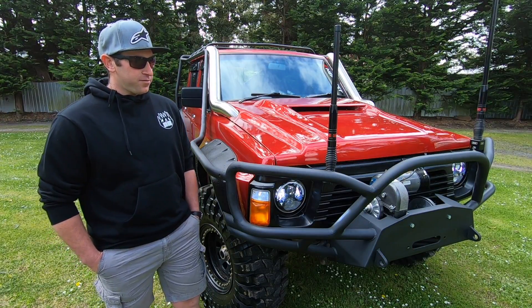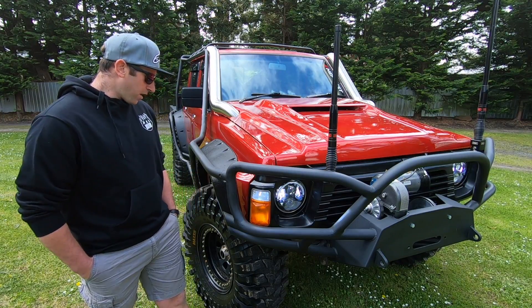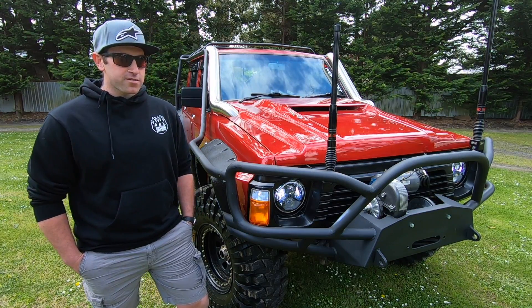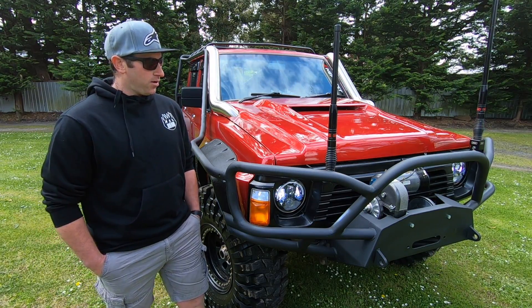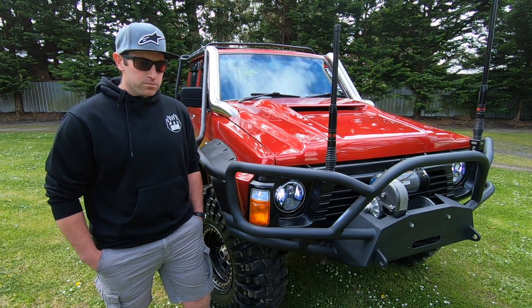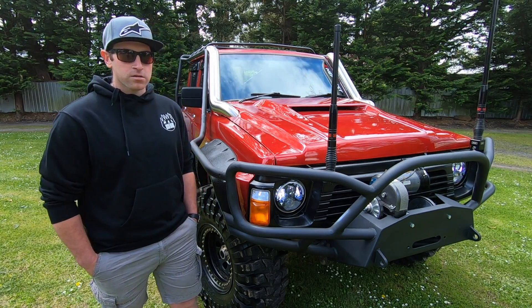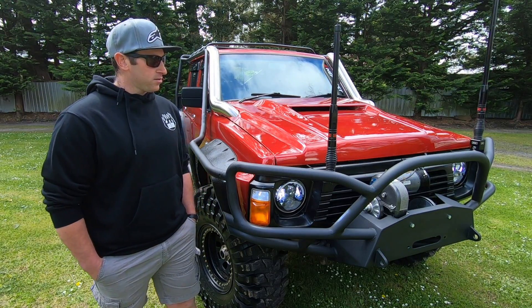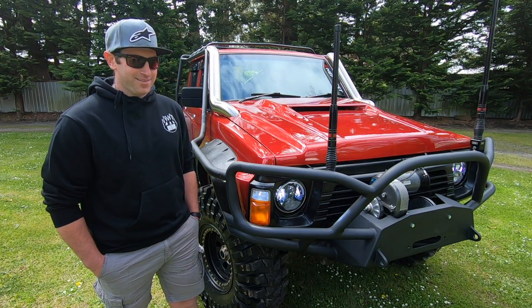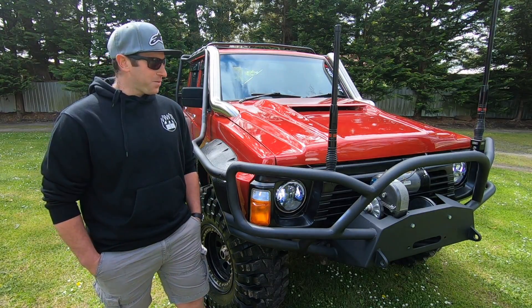For the event I have to get it engineered. For starters, the front sway bars scrub on the 38.5s, so that'll be coming out. I'll need the hydro bumps adjusted in the rear to suit the 38.5s. I've got to get the front winch wired up — new rope, fair lead, everything on. I've got a rear winch as well, so that'll be going in. Dual battery setup and lights going everywhere. I need to get my rear LSD shimmed because that's seen better days. I've got to get the sound system done so at least we can be pumping some beats.